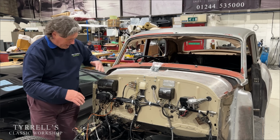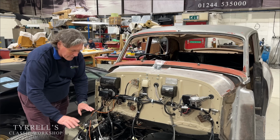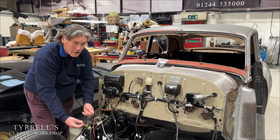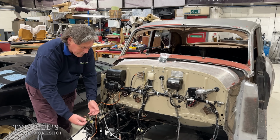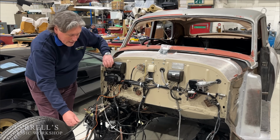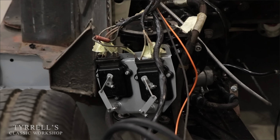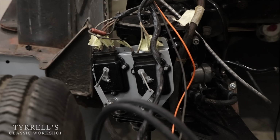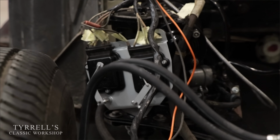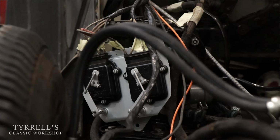So the inner wings here, that bolt here, are gloss black, and they have removable panels here, a rectangular removable panel, because the spark plugs, once the engine is in situ on the V8, are under the exhaust headers, the exhaust manifold, and they are almost impossible to get at from up here. So they actually have bolt-on removable access panels in the front inner wings. Crazy, really. Yeah, that was how they got round it.